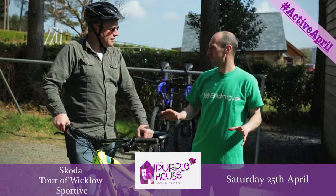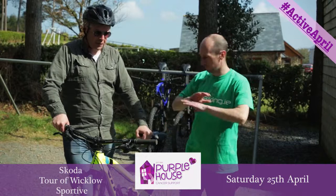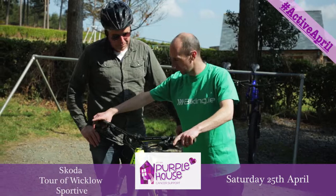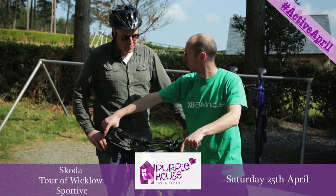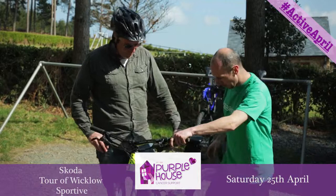So Ian, you haven't done a lot of biking at all. So what we generally do is rent the bike and go through the basic instructions on how to use the bike. From the very basics to your brakes — your front brake on the right, rear brake on the left. They're good, hydraulic, powerful disc brakes. So one, two fingers maximum. Reason being, if you have any more and you're not holding the bars correctly, you'll lose control. Always have your brakes covered with one finger at all times.